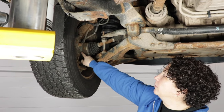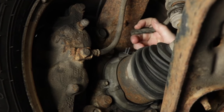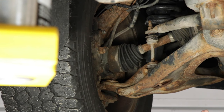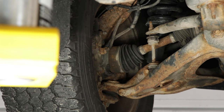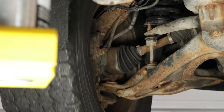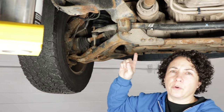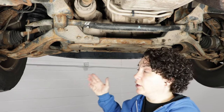This is the vacuum actuator at the back of this hub, and this is the vacuum line going down in there. So when Lenny puts it in four-wheel drive high and lets go of the brake to let the wheels spin — now it's working at this time, and so is this one. Four-wheel drive is working, which tells me I've got vacuum here, electrical's working, and the four-wheel drive motor on the transfer case is working.